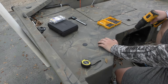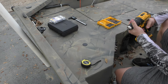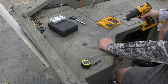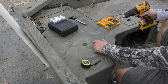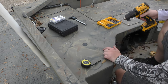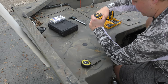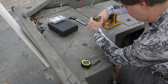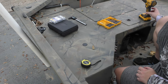I just want to start with some pilot holes for the center here. For all these I'm going to start with a one-eighth inch bit, and then I'll step it up a little bit more for the center. That way I can get my hole saw ready. Then I'll figure out what I need for quarter inch bits on these six on the outside. We're just going to begin here — I'm going to take it nice and slow. I want to make sure everything's as centered as possible. All right, there's one done.